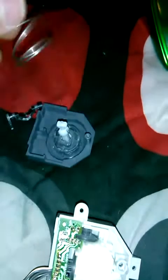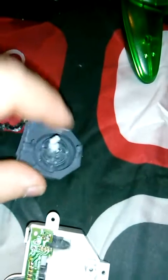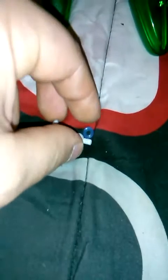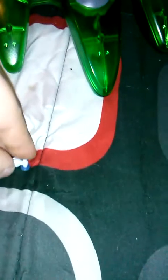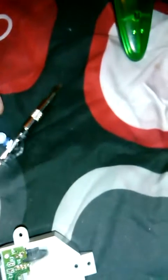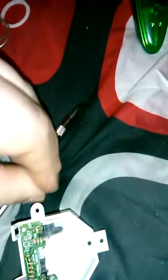I'm going to take this apart here. All you do is twist that and take it off. You can see how much it's eaten into — that's what is letting your joystick sag and not have any spring. Clean all the powder from the ground plastic out of there. Then you take this seal and put that on there like that, and it makes a very nice spacer.